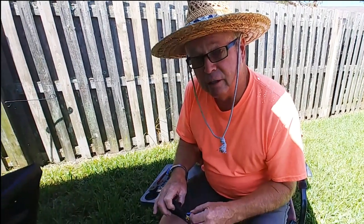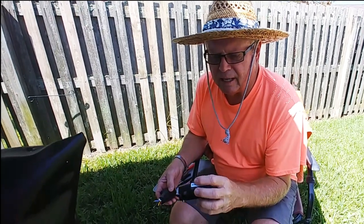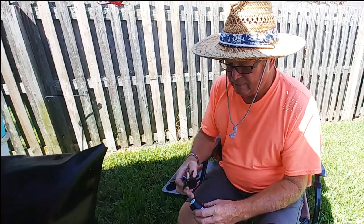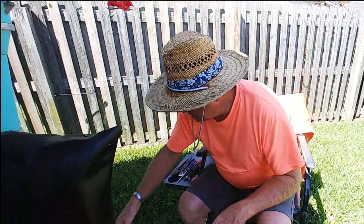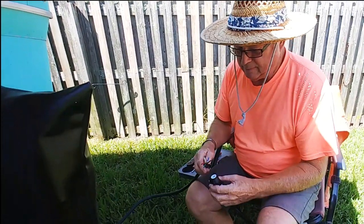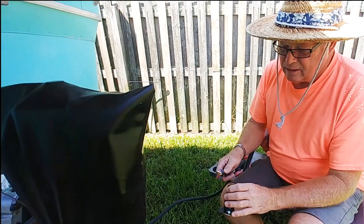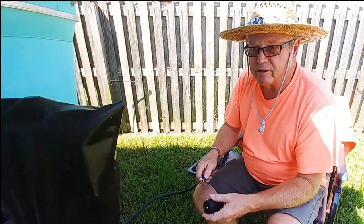I'm pretty sure how it hooks — I've got a hookup sheet in the trailer. Here's the new plug I ordered. This one was $8 online. It's a Curt, so it's a replacement plug for this one. The original is a molded-on plug, but I'll put a little silicone on this one to seal it all up; it should be just fine. Hopefully that will fix the problem of the lights going out going down the road and the indicator coming on saying I've got no brakes on the trailer.